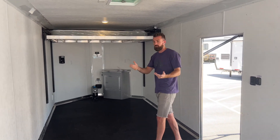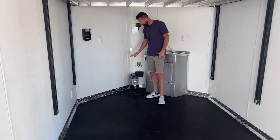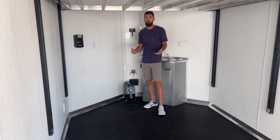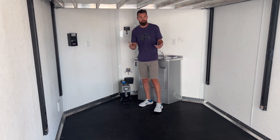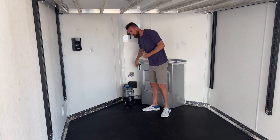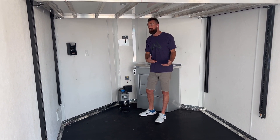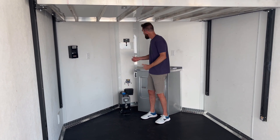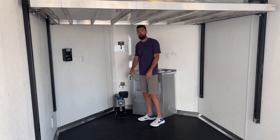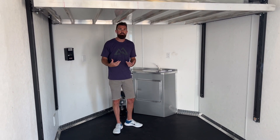We've got air conditioning and we went over the cooling. If you follow me up into the front here, we have a diesel heater mounted right here in the front of the trailer. This unit will warm this entire trailer and keep you comfortable even in cold winter temperatures — the insulation in the walls and roof helps with that as well. Right above that, you'll see a power inverter that takes 12-volt power and converts it to 110 so you can run your 110 appliances off your batteries without running a generator. We've got our solar charge controller pushing 2.9 amps to the batteries right now — batteries are at 13.7 volts — and a 100-watt solar panel on the roof constantly charging your batteries when you're out using this.